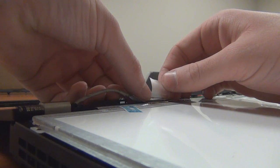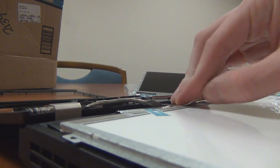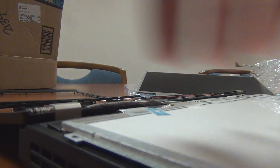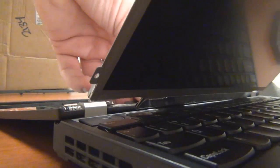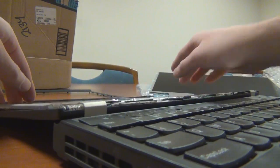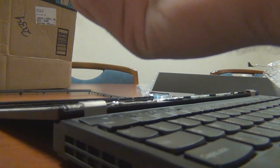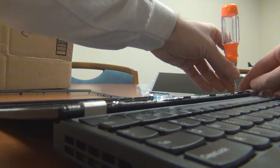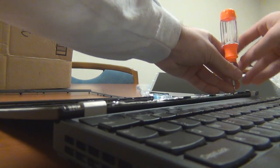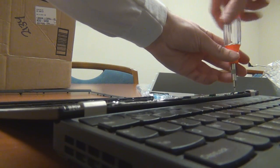Now we'll get this new screen, put it into place, and then just carefully slide the connector back into place and put the tape down. Just make sure the cable gets back where it's supposed to go. Put the screen in place and we are all set. Just like that, we have a new IPS panel in our X230 — or X220. This is pretty much the same procedure for both models. Just put the screws back in and tighten them down, but not too tight, because that puts unnecessary stress on the panel.